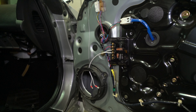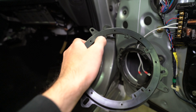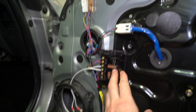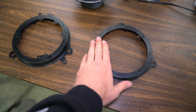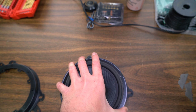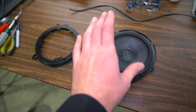We made some good progress last night but ran into one major issue — the speaker would not fit in the stock ring. The solution was to get these aftermarket rings that the speaker does fit in. It's going to take some modification — I need to trim these inner pieces off to make the six-and-a-half inch speaker fit. This is a set of component speakers, so from the amplifier it goes into this crossover and then distributes the lower frequencies to the woofer and higher frequencies to the tweeter. So I cut off these two ears, smoothed them out with the Dremel, and cut off all the internal tabs — now our speaker fits in there as it should.